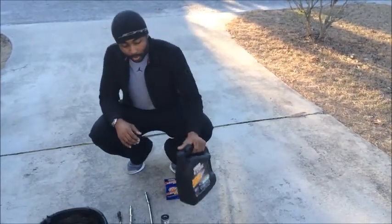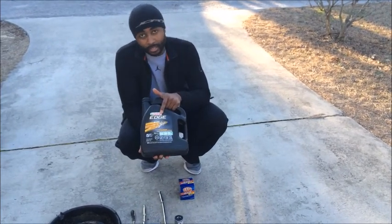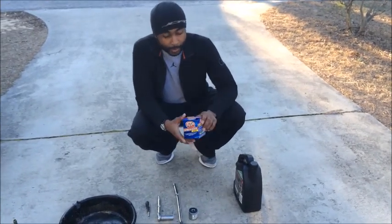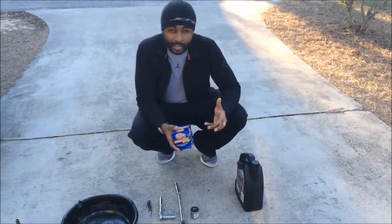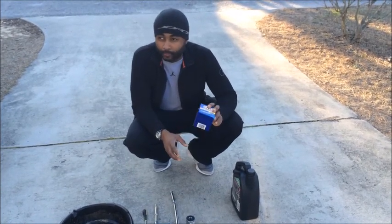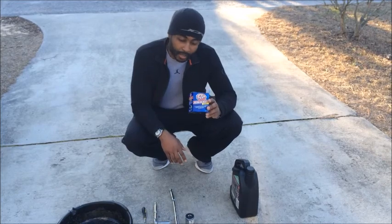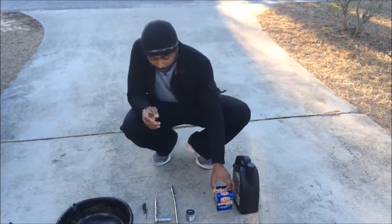First of all, you're gonna need oil. I prefer to use Castrol oil, which actually comes highly recommended by BMW, 5W30. Next thing is you need an oil filter. I personally use STP. You can use Bosch if you want to, but I think paying $10 extra, there's no point in doing that when this works very well. I've put over 30,000 miles on the car since I've had it, and I've not had any problems with these filters. The filter number is S9584, STP oil filter.